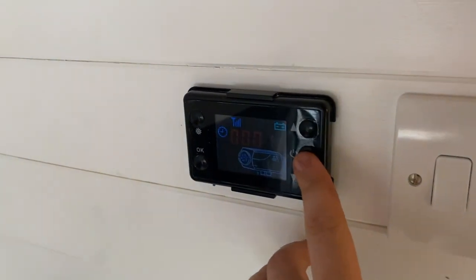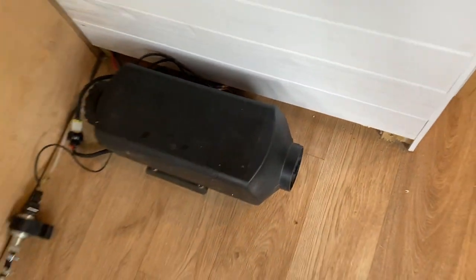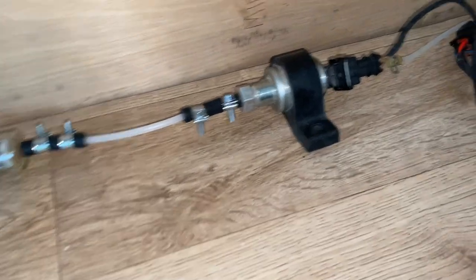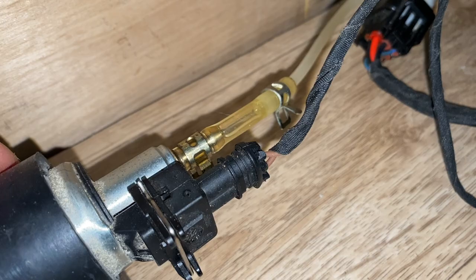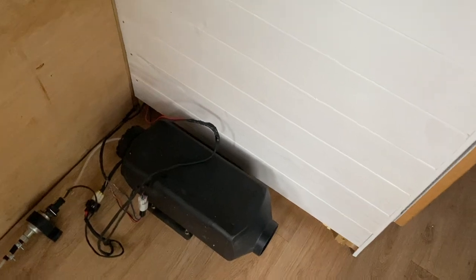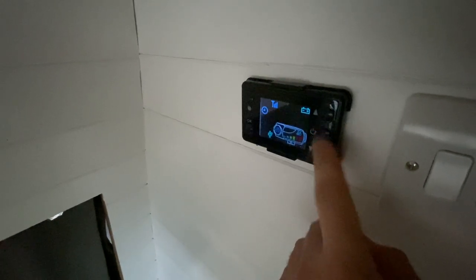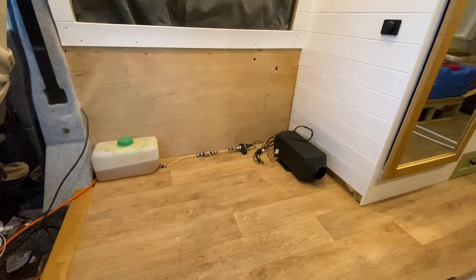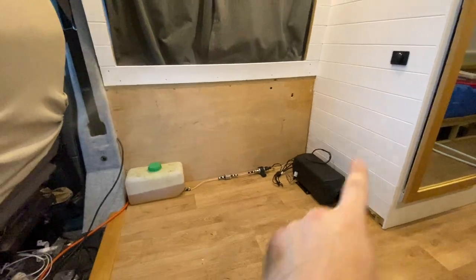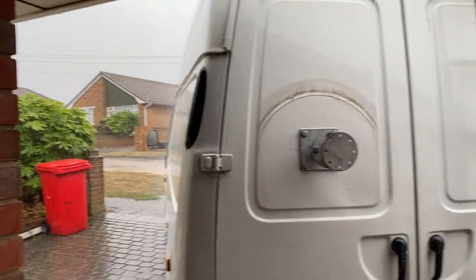Let's turn it on and see what happens. The fan started. The pump's clicking away now. Looking good. Throwing out some serious heat, that's for sure. Turn it off, let it cool down. And that's the diesel heater installed. Obviously I need to neaten that up when I fit this bench seat that's going to go here, and that'll be in the next video. No rain for months and then it all comes at once — thank God I managed to get that diesel heater installed.